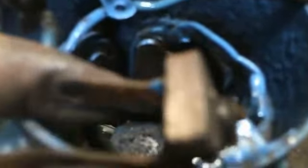We had one brush here that had a little excess arcing. So I took the old rat tail file. I couldn't show you this because I can't hold a camera and hold this brush and clean it all at the same time. Give it that little contour shape back like that, as you can see, to that one. So now we have the brushes there. Next thing is to start putting this together.